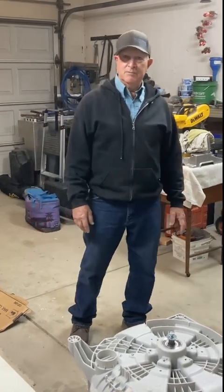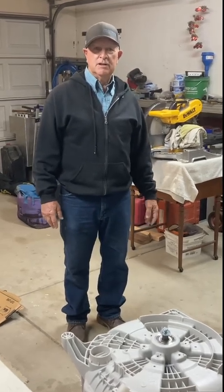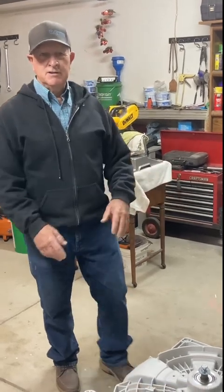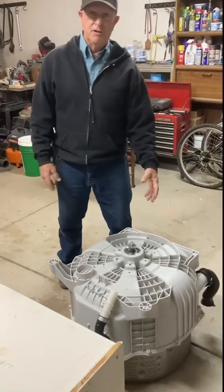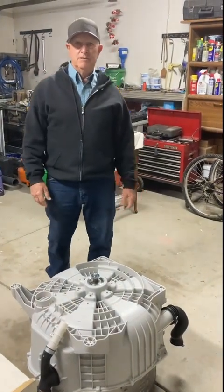I've watched a lot of videos and people fight this all the time. I found that the best thing to do is good preparation. You might spend a little bit of time making a couple of tools for yourself, but in the long run they will pay off. One thing I've noticed is a lot of times they leave the stator assembly on the tub — we have removed it already — so just make sure you remove anything that's going to be within the working area of these bearings.